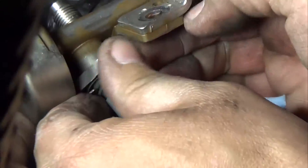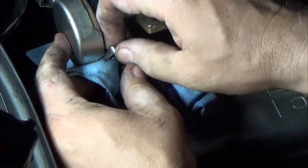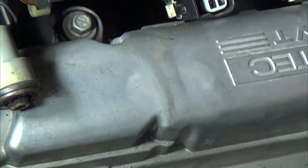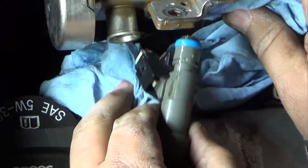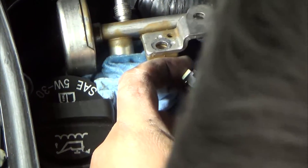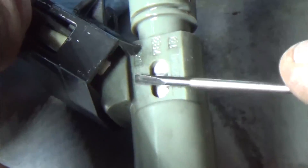Okay, first thing you want to do is take the clip off. Sometimes it can be difficult, especially with stuff in the way. There we go, take that clip off. There's probably going to be fuel coming out — nope, it's already coming out on the side. I've already taken three of them off so hopefully there's not much fuel left. Just got to kind of wedge it out of here. Like I said, you're going to get some fuel coming out, so just put down a towel or something. Then push this white thing up so it slides back, push on this tab, and the injector comes out.